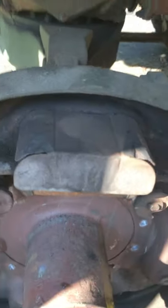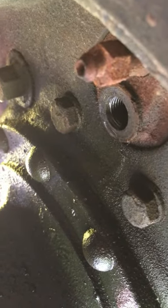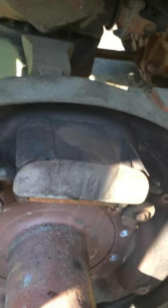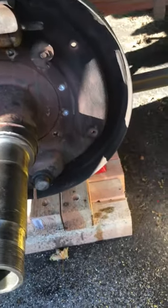The only thing left on the backside at this point is the wheel cylinder, which I've already taken off. It's got an adapter block that goes on the cylinder itself — that's a 7/16 and the banjo bolt that goes on the adapter is a 3/4. What I did is just loosen up that banjo first, took that block out, bent it out of the way slightly, put a screwdriver through it, and then loosened it up so we are ready to go. It's going to get loud in here, so we'll cut right here and I'll show you after.